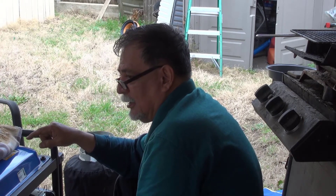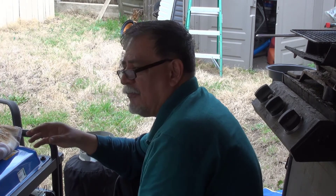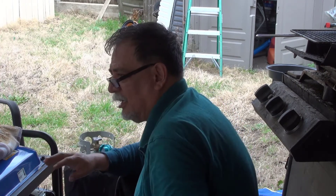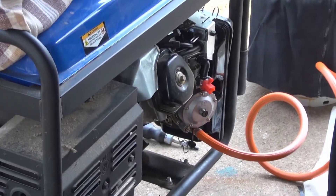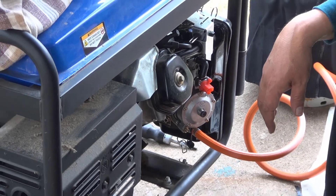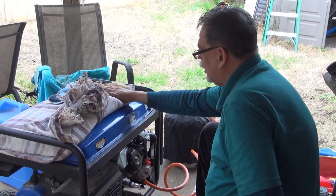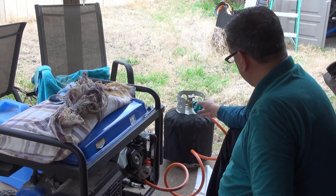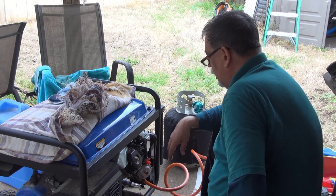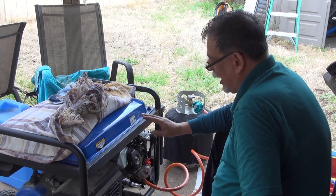You can see the amount of dust this one has, and I think that's the problem with the automatic choke — it goes on and off until it runs out. The governor can't adjust properly, which is normal, especially if you're not used to old carbureted equipment. Once you put a load on it, like a lamp, it adjusts automatically because it's drawing power. The UST 5500 is now ready to run on propane. You can run it from pipes or leave it on gas.